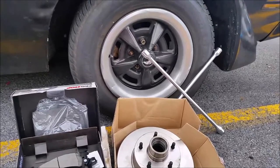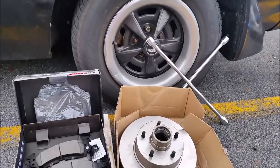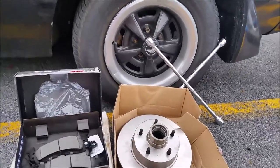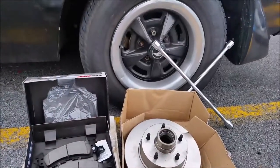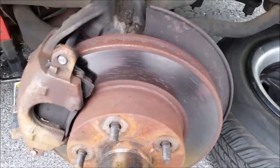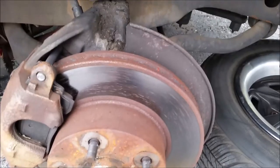The obvious first step is to lift the car up and take the wheel off. I'm gonna remove the caliper, then we're gonna have to disassemble the spindle to get the new rotor on. Always safety first — make sure you have your jack stand and put your tire underneath just in case it falls. The rotor actually isn't in too bad of condition physically, but there is definitely a vibration somewhere in this rotor.